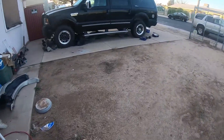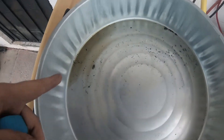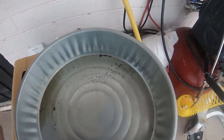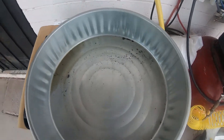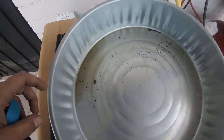It's kind of getting dark pretty quick, so I want to see if I can get this video done for you guys. All these particles did not come out of the front diff — it's actually when I was prying the CV axles out, it just fell into the pan. I missed 90 percent of the front diff fluid because of where I had the jack stands.